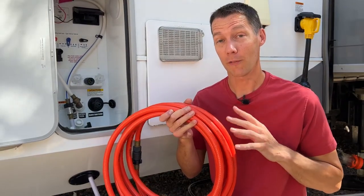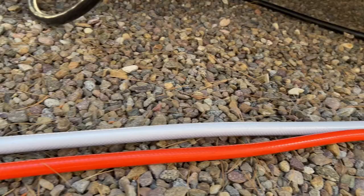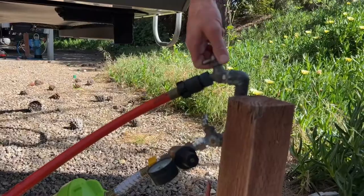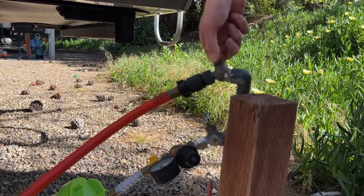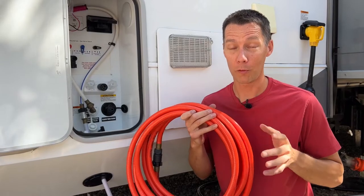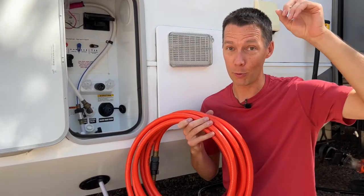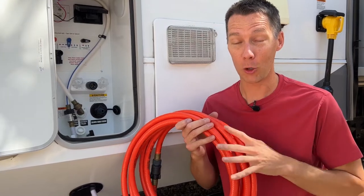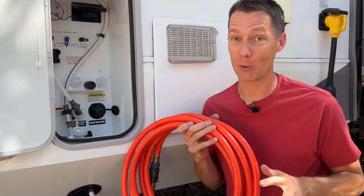Let me show you how I use this hose to flush my tanks. This hose lays next to the RV when it's not being used — it's not hooked up to the RV. That way if the water spigot is accidentally turned on, it's not going to overflow my black tank. If this were to happen, water can overflow from the tank and come out the vent on the roof, or worse yet out the toilet and flood the bathroom. Don't leave your hose hooked up to the RV when it's not in use.